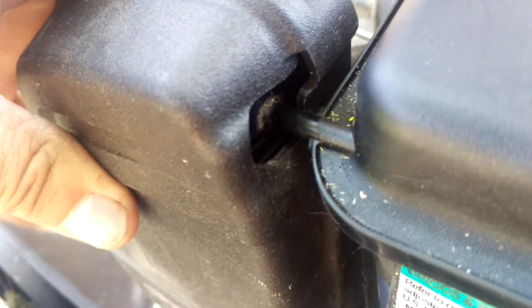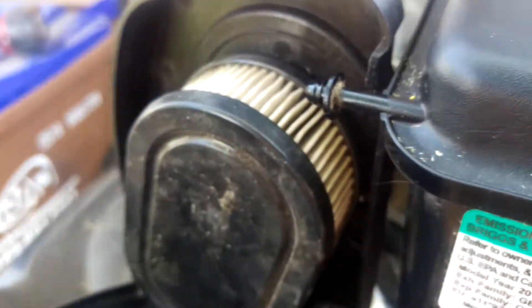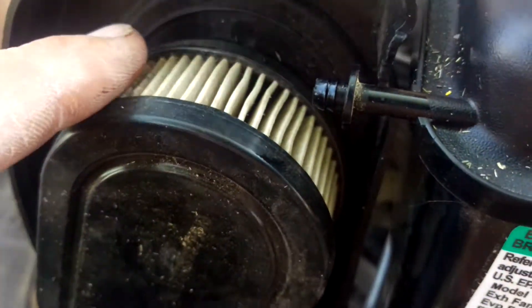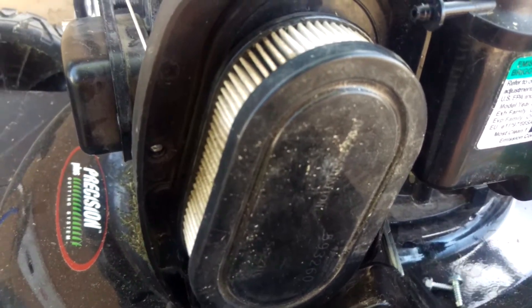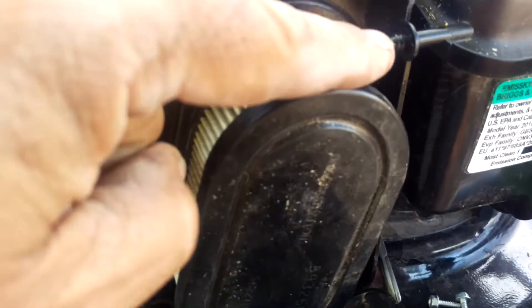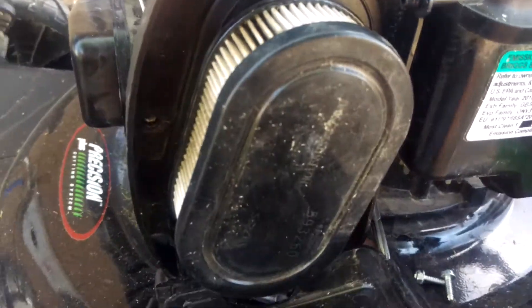I'm gonna have to go online and look and see if there's a piece with maybe a one-way check valve or something, because the end of this piece of plastic is barbed — like it's gonna receive a hose. If you know what I'm missing, let me know. I'm just gonna do the carb clean and reinstall it, and look up that part. It's just gonna keep sucking more junk in through that hole and we're gonna have to do this all over again. I need to find that piece so I can see Mike once a year instead of once a month.